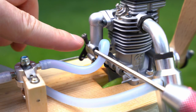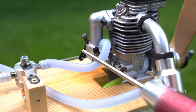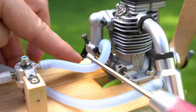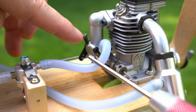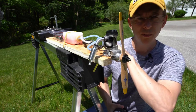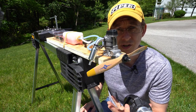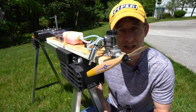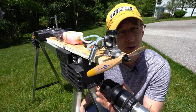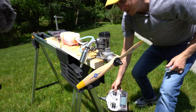You may have to adjust the bleed valve assembly. The third piece is on the back side — this is the adjustment for the opening of the carburetor. In the back you can see the throttle linkage moving. If the carb isn't fully closing or fully opening, this adjustment may need to be turned — usually a quarter or half turn at a time — to fully close the carb. Also, I like to use electric starters for all my engines. You could use a prop stick or chicken stick, but it's very difficult to keep the engine spinning and get good ignition, so I'd definitely pick one up.